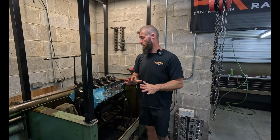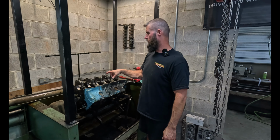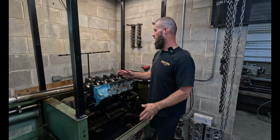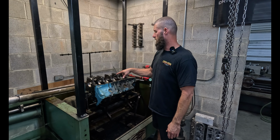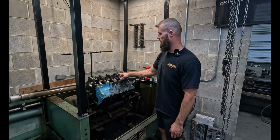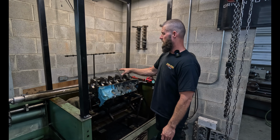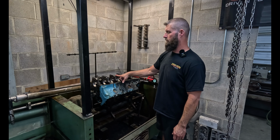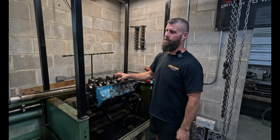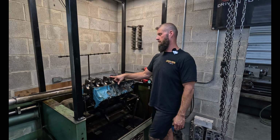So anyway, I was in the middle of all this and we had a cap or two that we had to cut. I ain't looked at all the footage, so I'm just gonna go over it. So we had, to start with, the thrust was still a little big, so we trimmed it another thousandths just by itself. And we got it in, and then this one had a little shadow over about 3 o'clock, so we trimmed it again.